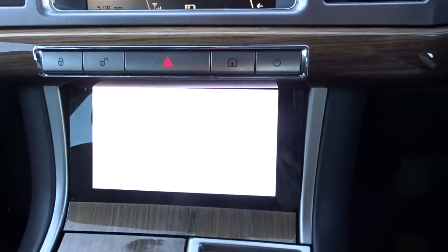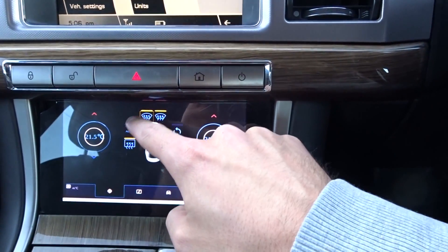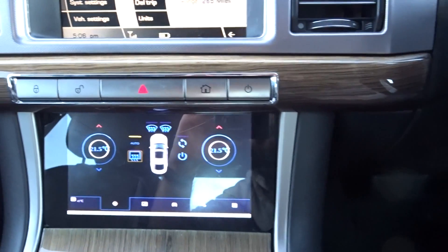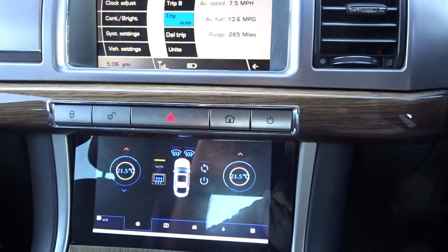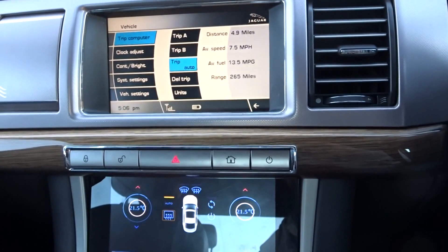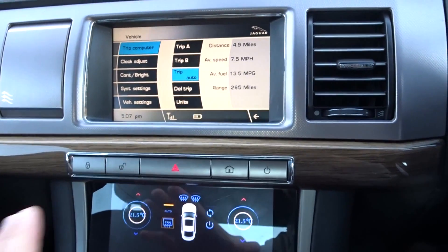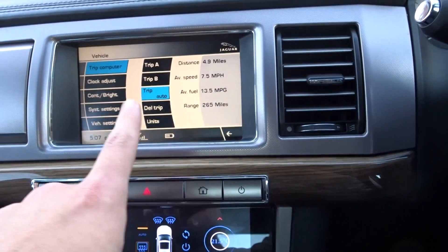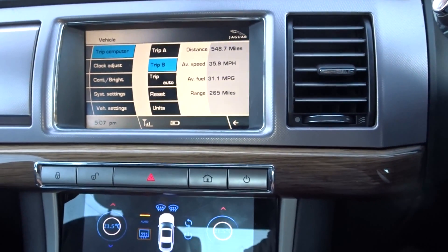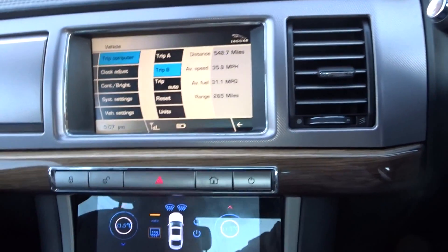You can navigate back to the main page, which works as it did before — just redesigned to be more visually pleasing. I've been looking into replacing the screen as a whole, which is still quite a way off because I need more functionality on this screen first. But it's definitely doable. I need to get all the read-only data working first, then look at the write messages — when you press a button it's writing a message — I think I can pick those up. So read-only data first, then start taking over some of the write functions.